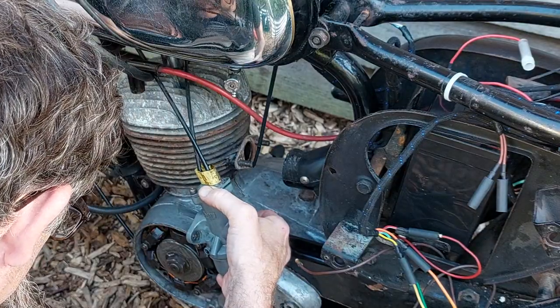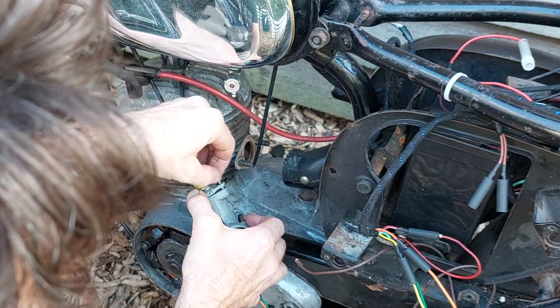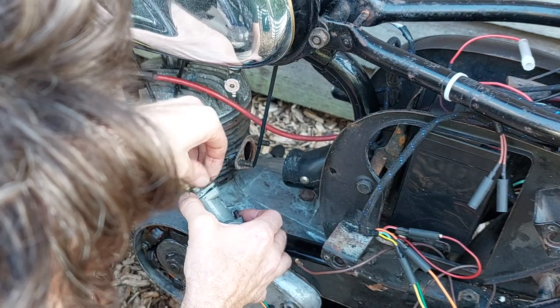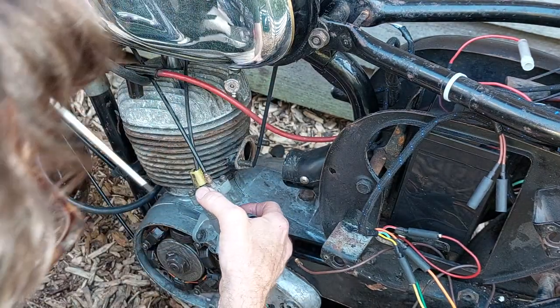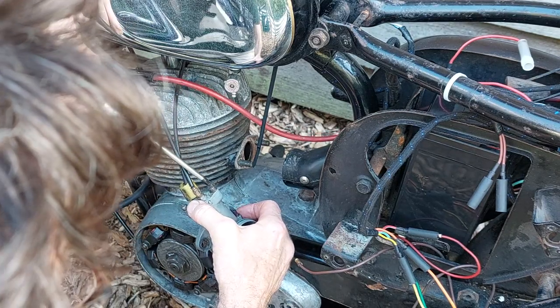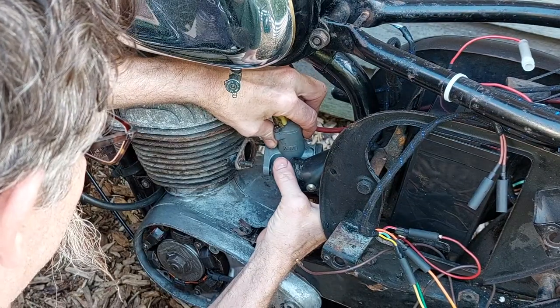So the carburetor looks okay, so we pop that on the bike. The first thing you do is put the slide back in, making sure that the groove on the slide lines up with the indexing screw on the side, and then feed that in. And then the needle is loose, it moves around side to side, so you need to pop your finger down through the inlet hole and guide it into the main jet as you feed it down.